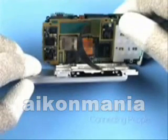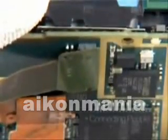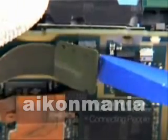Separate the assemblies, keeping in mind that the flex foil is still connected. Be double careful while opening this connector — do not destroy the hidden components underneath. Now the parts can be separated.